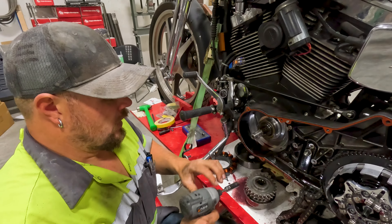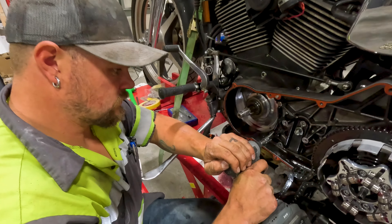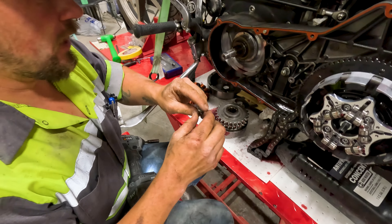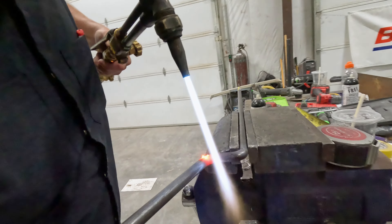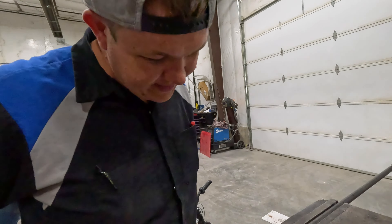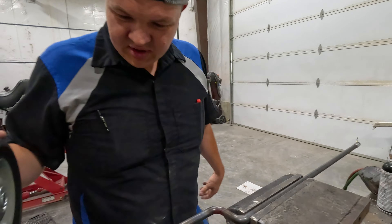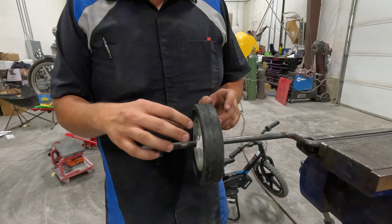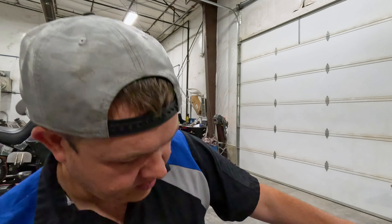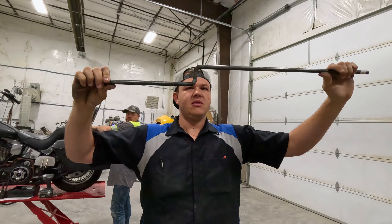Learning exercise. I've got to go down a lot more, then I'll have to let it cool and bend the other side. That's much better. So we've got a 90-degree angle. That works — we've got a two-inch drop. Now we'll do the other side and then this will go on. We'll drill a hole, washer it and pin it — that's how we're going to keep them on. That's pretty dang good for being an eyeball job.